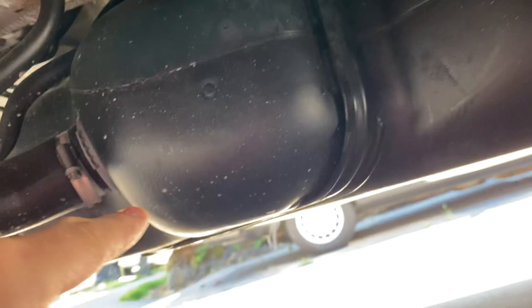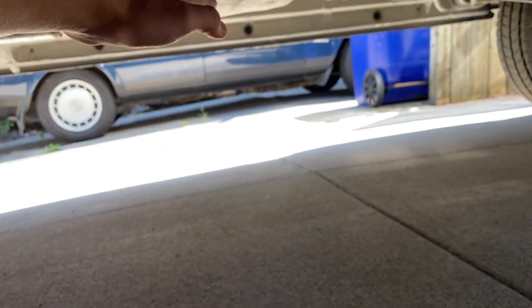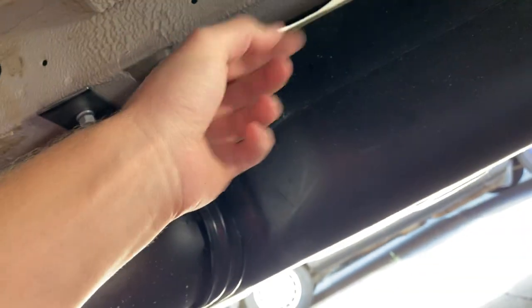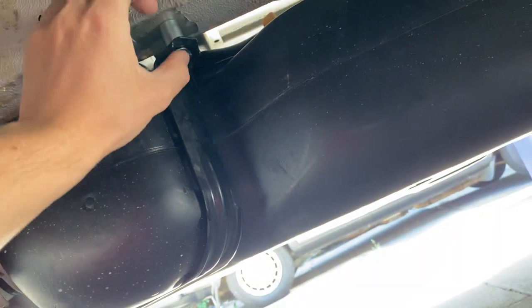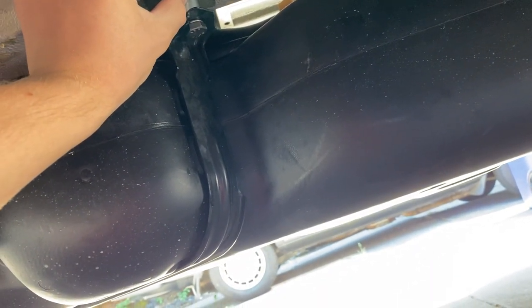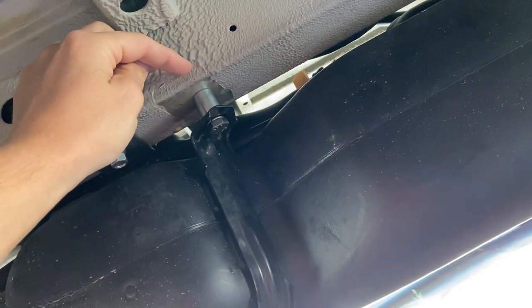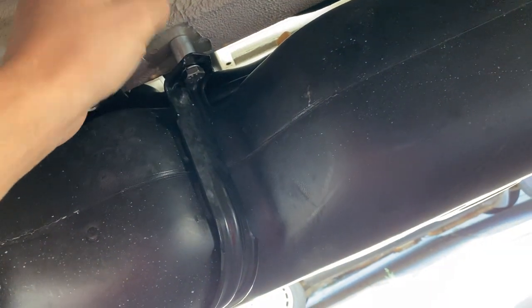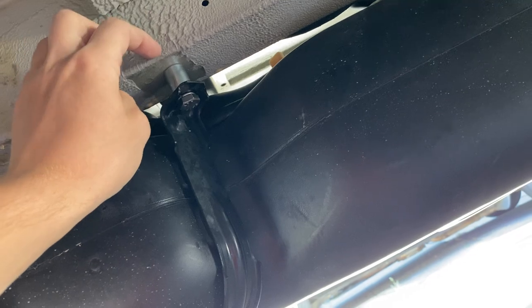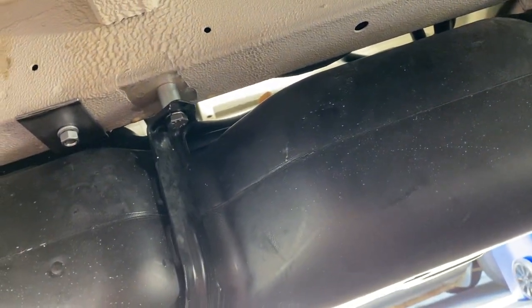What you need to do is lower the tank. I used the car's jack, placed it underneath, put a wooden board on top of the jack, tightened it against the tank, and then unscrewed each of the OEM screws — starting from the back, though the order doesn't really matter. The OEM screws are metric M10, 1.5 pitch — pretty sure that's what they were. They're quite short, but there's a captive nut inside the beam for each one, so once you figure that out it's really easy. We got longer screws to replace them.